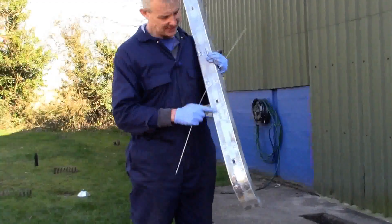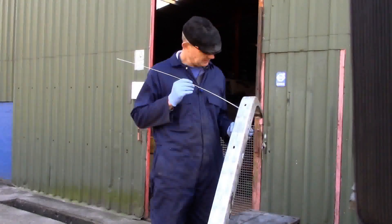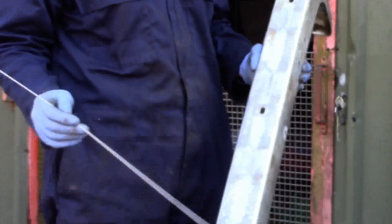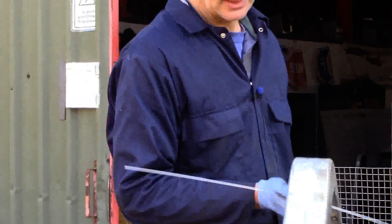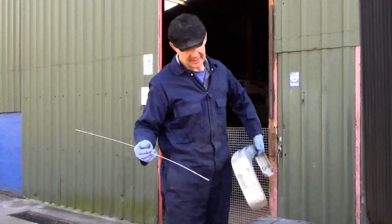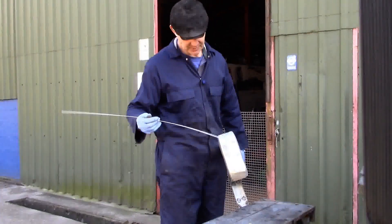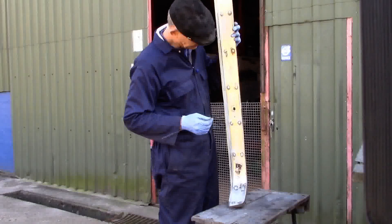There's our dressed bumper. There's a small hole here and a couple of shallows here and there, but I think when Nigel puts a lick of high build undercoat on it most of that will disappear. The corners have worked fairly well — those were the difficult ones where the metal had gone very thin. I'm really pleased with that. For an amateur, that's not that bad.